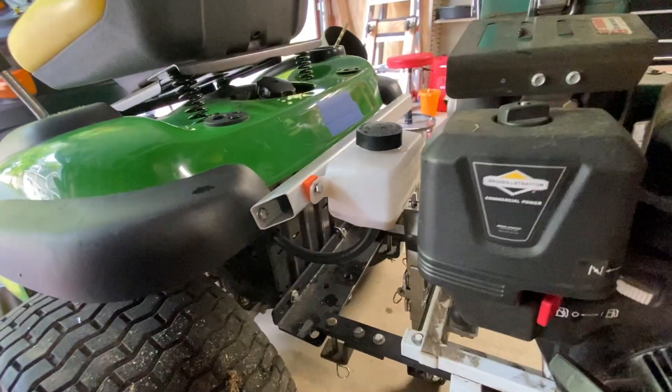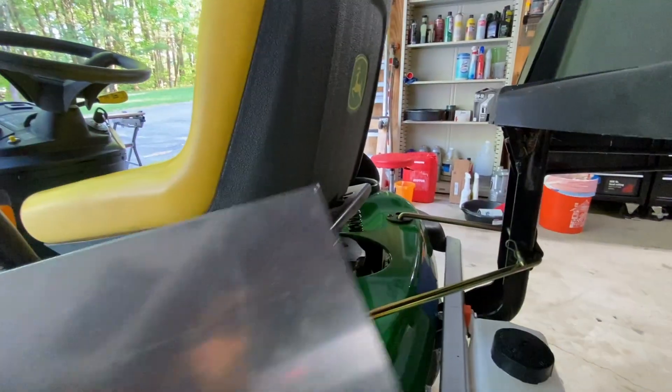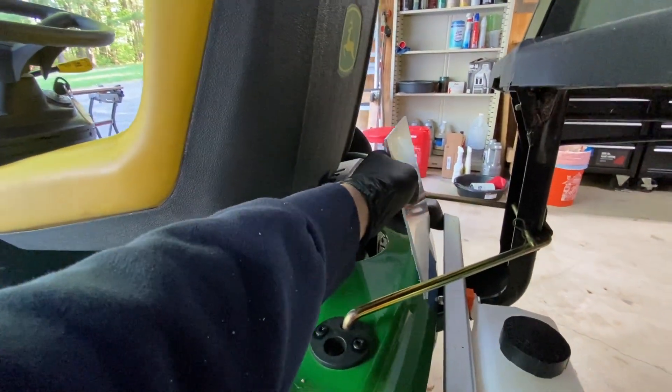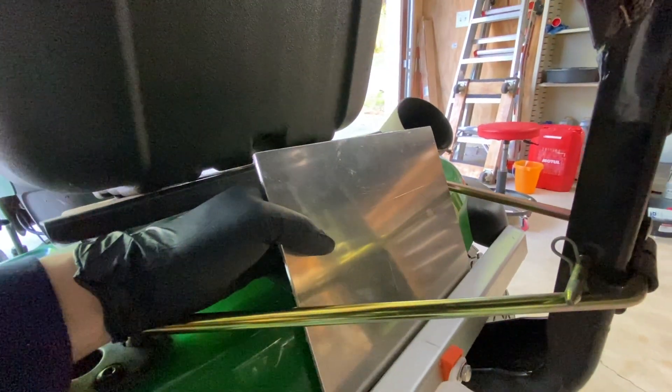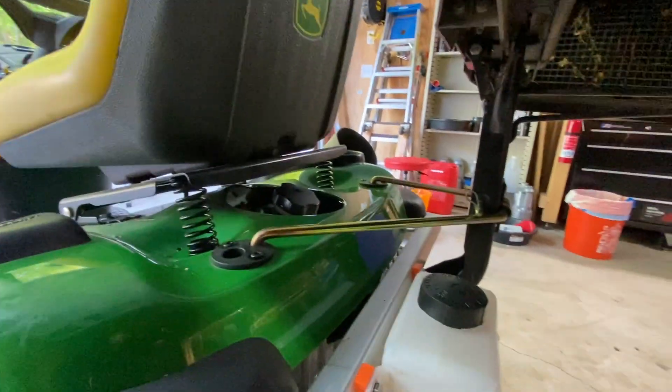Thankfully I didn't drill through the green body of the mower and mounted the tank on a piece of aluminum square tube that's attached to the fenders. So I cut a piece of eighth inch scrap aluminum sheet to fit between the bagger support bars. I'm going to attach the aluminum sheet to the square tube that the tank is currently mounted to, then move the tank on top of the aluminum sheet, effectively making a new bracket.